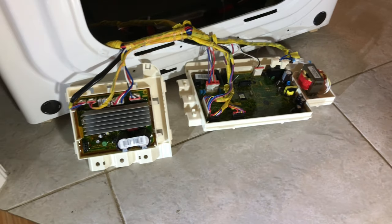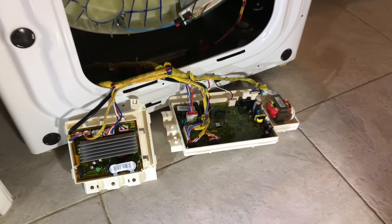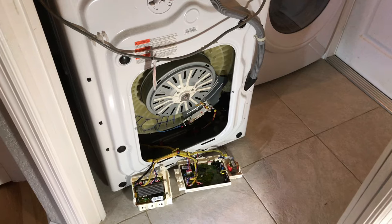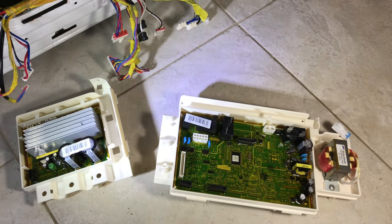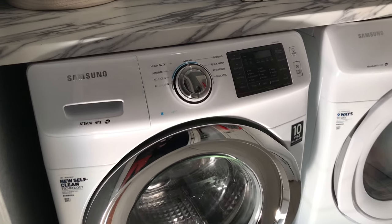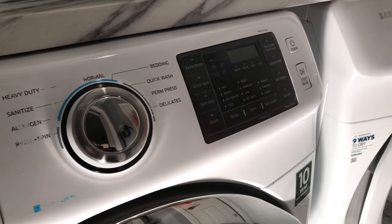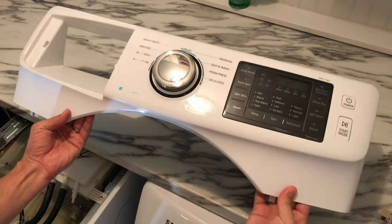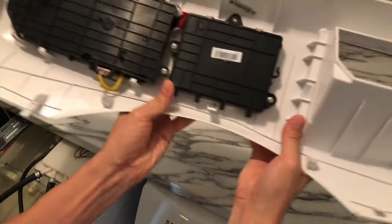This particular washer actually has two logic boards. The one on the right is the main logic board, and on the left we have the power control board. Each of these boards will cost up to a hundred dollars to replace, but I don't think both of them are bad, so I'm going to test them and figure out which one is bad. Keep in mind this washer also has a third logic board — the user control board — at the front with all the buttons, display screen, and scroll wheel. If the main logic board and power control board seem okay, you may want to check that board as well.